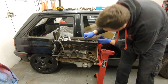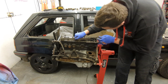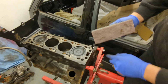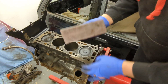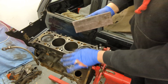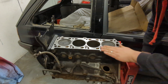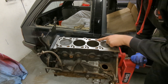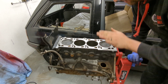Using a straight steel rule to check the block — it looks good, no visible low spots. Then going over the top with a flat sanding block and 400-grit abrasive cloth just to confirm — and it cleans up really well. Another indicator this is a low-mileage engine: the water galleries are in really good condition, not rusty, still with all their original shape.